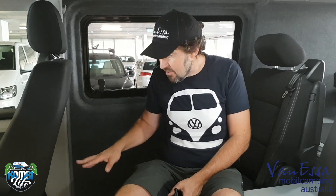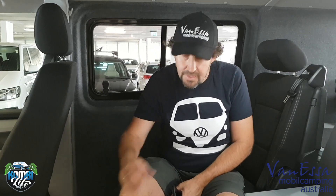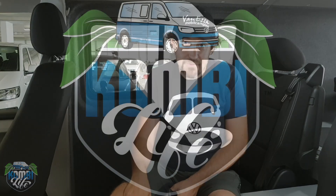Furthermore, with the 25-amp IDC25L underneath the passenger seat, if I run the engine for two hours, I'll be putting a good 50 amps back into the battery. So that's a look at the auxiliary battery system, permanently mounted under the seats — in this case with lithium. We could of course put a conventional battery under here as well, with a conventional charger. Thanks for watching.